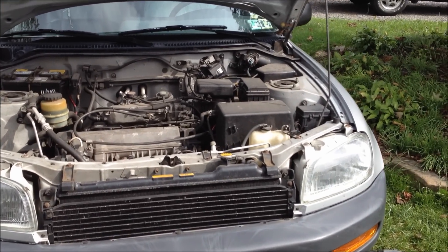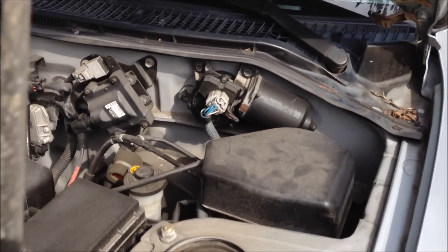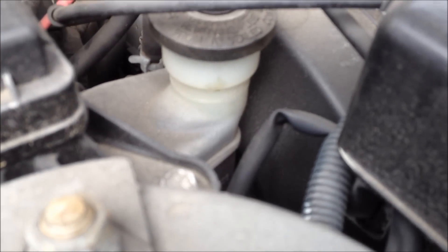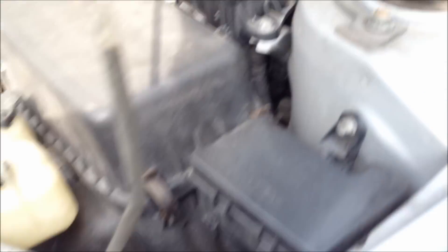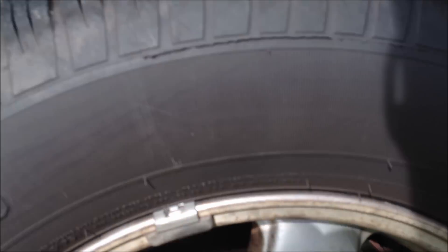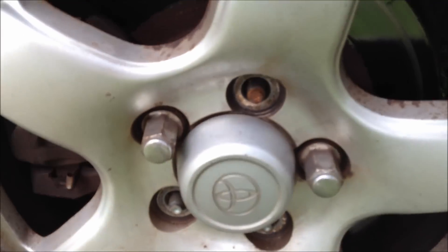Here is the 97 RAV4. The brake fluid is in here. My fluid level is a little low. I also know that the brakes were getting low because my wife said she heard a grinding noise. And right here is the grinding noise — it's just starting to scuff the rotor. So I've got my vehicle supported and I'm going to go ahead and take this wheel off.